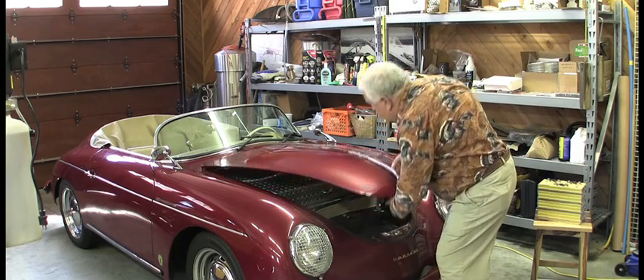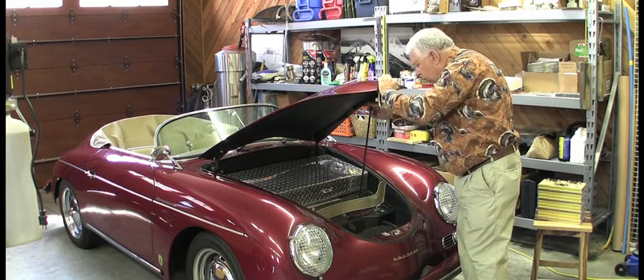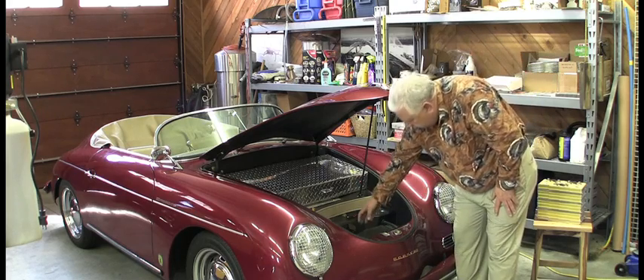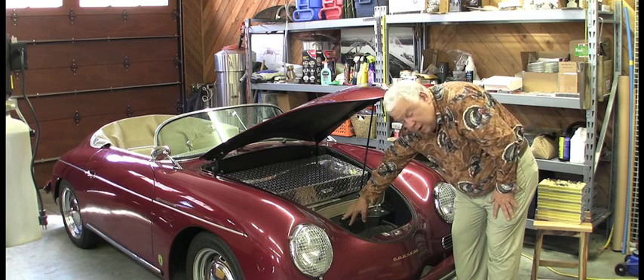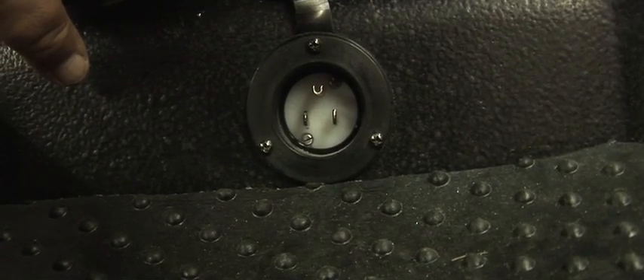The charging process is pretty simple. The Porsche, like most of the Volkswagens and the Beetle, had the gas tank up front, so you had to open the hood. We followed that same approach and put a small Revco recessed 3-prong connector in the front of the car. Underneath our protective cover we have essentially a standard 3-pronged male plug in a recessed receptacle.